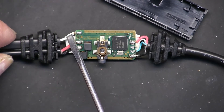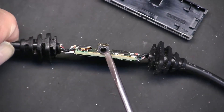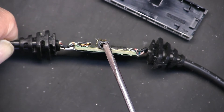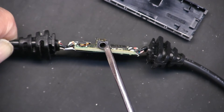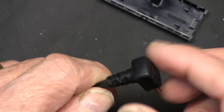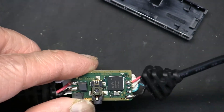The answer is that this white wire is the antenna cable — it's simply an FM radio antenna to receive traffic information. It's not supposed to come out the other end. It's also connected to an external antenna port on the unit, which you can use if the signal is weak and you want a stronger external antenna with a longer cable.